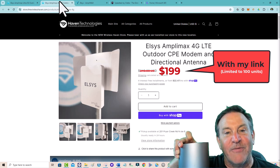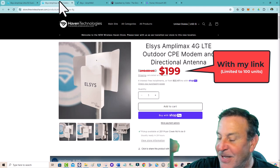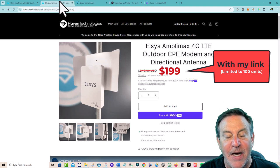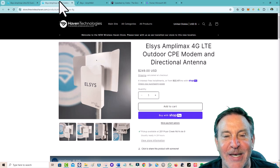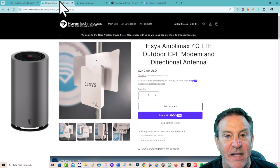Guess what? It's 5G NSA. It uses 4G signal as its primary signal. It's not going anywhere, so 4G is totally cool. In fact, they're just getting rid of 2G now. So there's going to be a long life for this thing. The 5G modem that you have is probably pulling in a 4G signal as its primary signal. If it's from T-Mobile, that's exactly what it's doing.